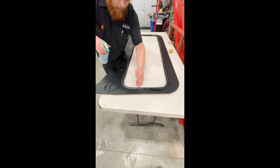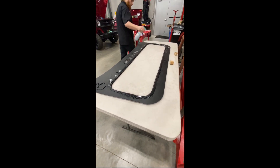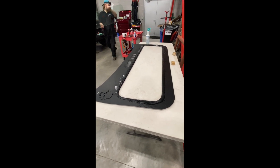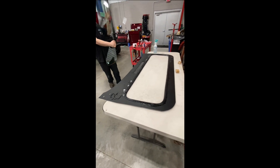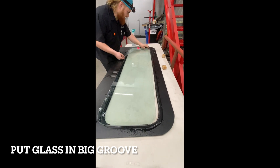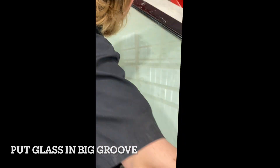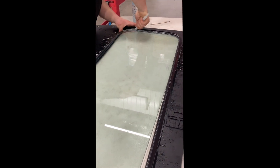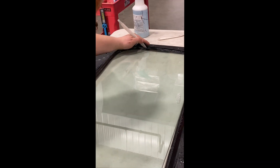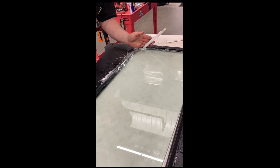We're just using a white plastic table — you probably don't have too many workbenches this big in a personal garage, but the wife might have a little picnic table she won't miss for a few minutes. I usually start on one end and try to get the glass into the big groove along here, then get one corner in, push it up, and this is where your plastic tools come in. You just stick it down in there, pry it up and around — sometimes you gotta slide down on the glass.